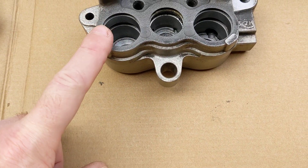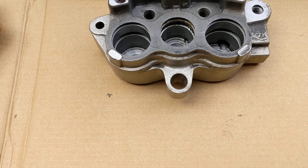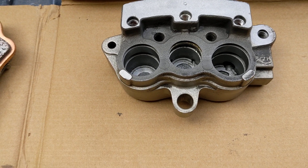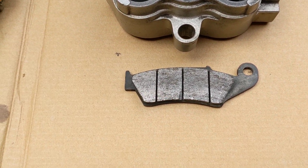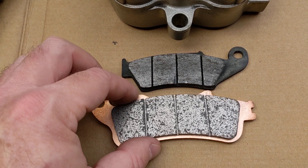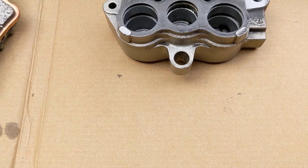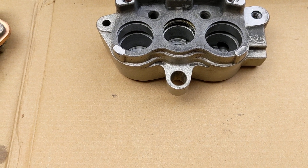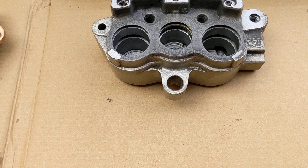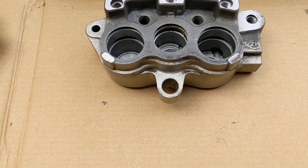Why have I gone with that piston? Well, it's a three-piston caliper. The WR250 is a two-piston with two 27mm pistons. This one increases the piston surface area, and the pad size of the WR250 is that, while the pad size on the Honda caliper is that — so that's going to increase the braking a bit and work a lot better with the 310mm disc. The 310mm disc is six millimeters thick; street discs are five or six millimeters, whereas the dirt disc is three and a half millimeters. So you have to shave the pads a little bit to get them to fit. This will be a better caliper setup for the motard wheel.